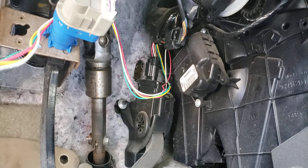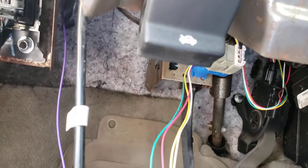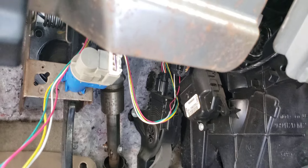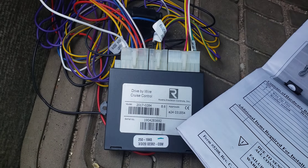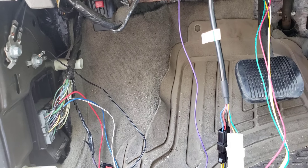It's just a plug-and-play as far as the throttle — that part's pretty simple. This wire going here just plugs into the throttle clip up there. This purple wire goes from the module to the vehicle speed sensor on the transmission — I'll show you that in just a minute.